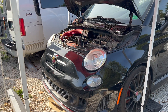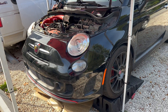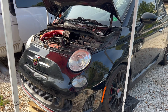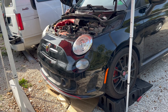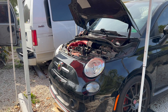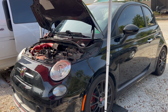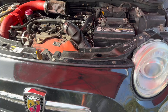This problem is pretty unforeseeable. I was honestly just going for a spin after I had fixed some boost leaks, and the car was pulling super hard, broke traction — the front wheels were spinning. I believe the vibration from the wheels spinning must have loosened up a piece of the tone ring that was probably on its way out. So if you guys are experiencing these issues, you're probably going to have to pull your transmission, do your rear main seal, and replace the tone ring.